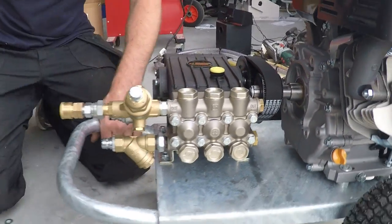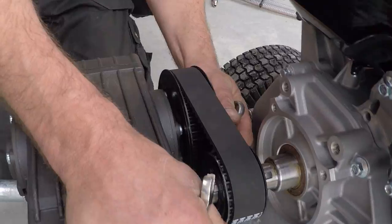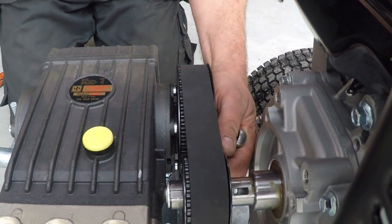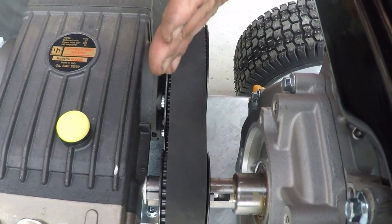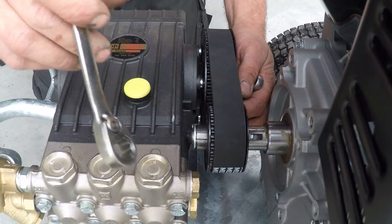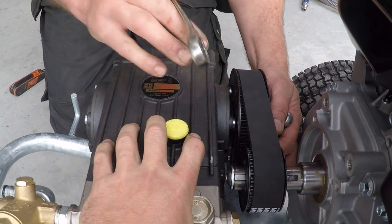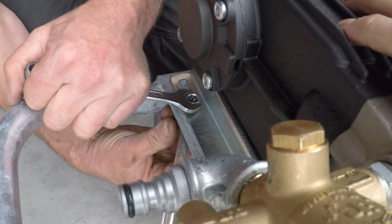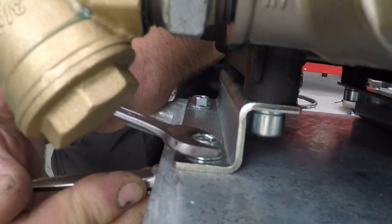Not too tight, just enough, because you'll need to be able to slide the pump to put tension on the belt. Have them semi-tight. You'll need your 13mm socket. When you're tensioning, make sure you also pay attention to the alignment of the two pulleys — keep them straight. See, nice and straight. Whereas if I pull it like that, see, it's sort of toed in. So keep it tight but keep it straight in line. You might want to ask somebody for help — your brother or someone who works with you. The cameraman can hold it while I tension it.